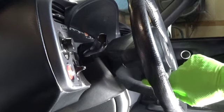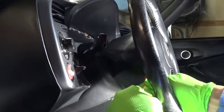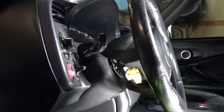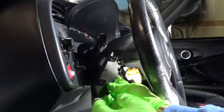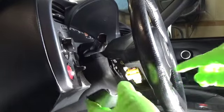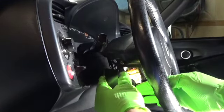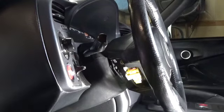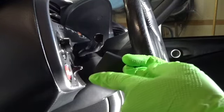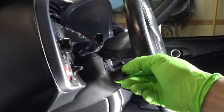There's a little tab on the forward edge of the large cover. If you come into it with the pick, you'll be able to pull it straight out. The way this is set up, there are two tabs that insert into this section here, and then on the other side it's just snaps. So you're pulling it away from the snaps and then pulling it straight out. Same thing on the other side — pulling from this edge, then the tab here inserts in. It's a real simple procedure.